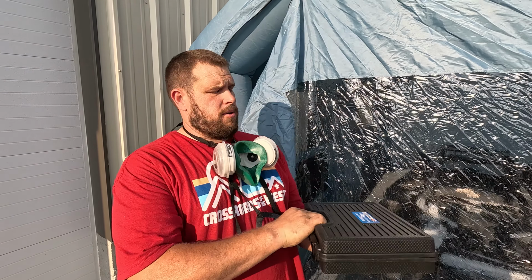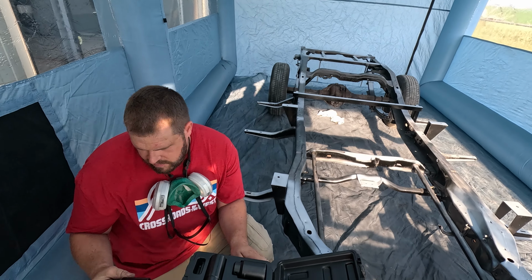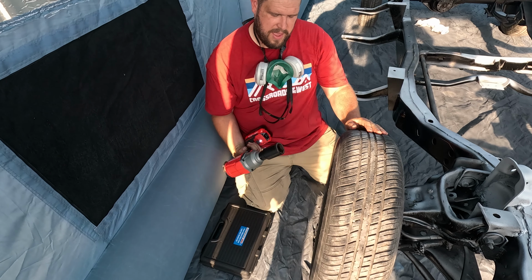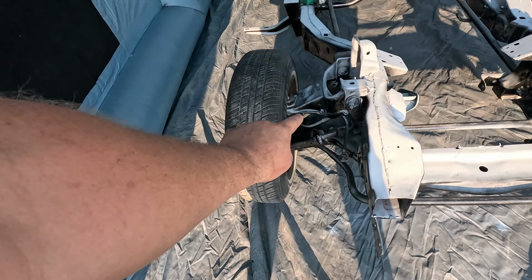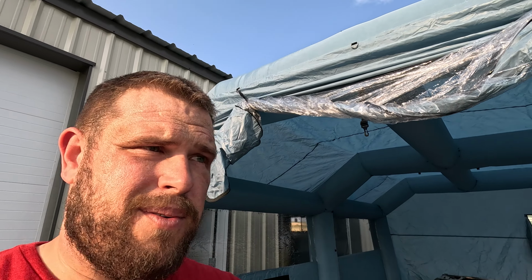Back, which is great. So we're gonna try that out, and we're gonna see what socket best fits the thing to pull it out. So they say it's a 35. Wow, and it zinged it off quickly. We got the CV shafts out, and we scraped the grease off, cleaned it up, so they are ready to be hit with the paint. Here we go.